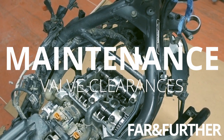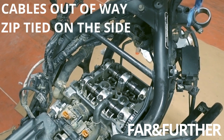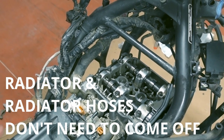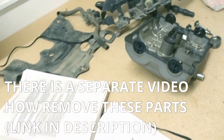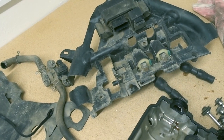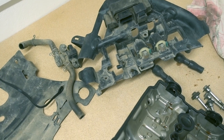So this is the state you want to be in. In order to get here you need to take obviously the tank off, but also a lot of stuff which is in here. What you need to take off is the cover, but also all the brackets, all the electronics — this is the pair valve and this is the thermal heat shield which is actually under there — so all that needs to go out.